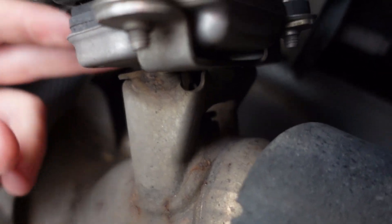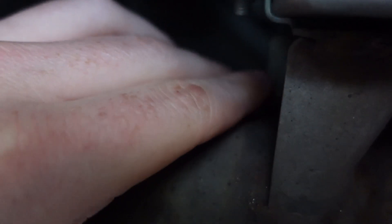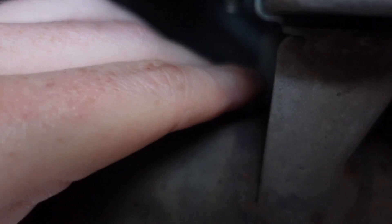It's called a flex or an actuator clip — two different names for it. Now when I get my hand round here, you can hear that banging. So that clip on mine has actually snapped clean off. When I'm pushing that manually, that is actually the valve opening and closing. So that will need replacing.